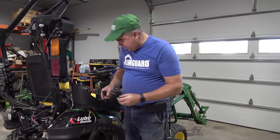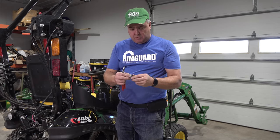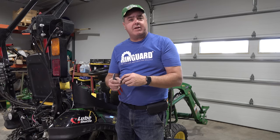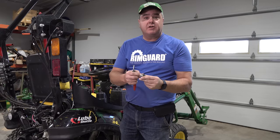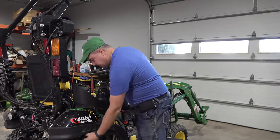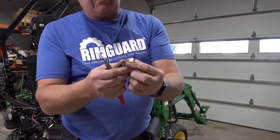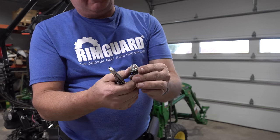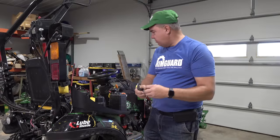This is the bolt that is in the base of this cubby here that goes through the fender. I didn't put a backer on it — I just put the wrench on it and spun it right out. Then I realized I actually broke it off here — I broke the fender. So make sure you put a backer wrench on this lock nut under the fender, otherwise you'll tear up your fender. Now it's not a problem to me since I'm putting a new fender on anyway, but if I weren't, that has risk of not going well at all.